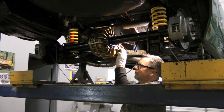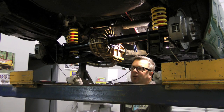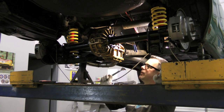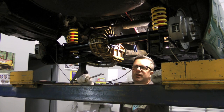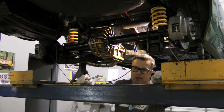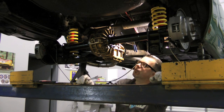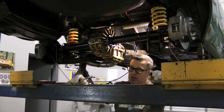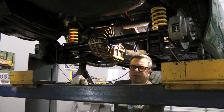There's really no good fix for that - it's time for a new ring and pinion. This is not a job you can do at home; it's not even a job for your favorite Alfa mechanic. This really should be done by a specialist who has all the tooling, because the end play on the gear between the ring and the pinion has to be set exactly right, requiring very special shims that are somewhat hard to come by. Don't try to do it yourself - it seems fairly simple but you create a lot of trouble and could destroy a fairly expensive part.